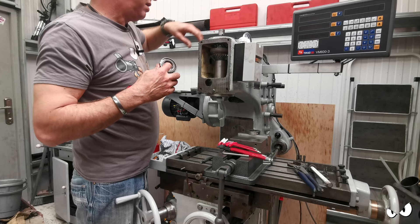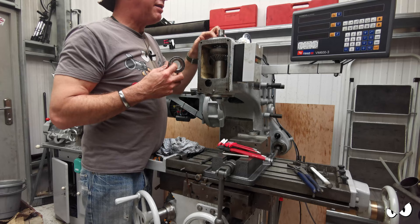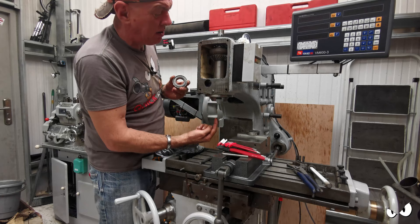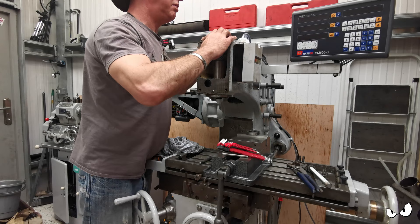New race is in the top, which I've got mucky as hell now. It's all right, it's just going to get cleaned out with oil. To get that race in, you basically have to bosh it through this hole when the spindle's out and you can knock it out the top - a bit of a faff but doable. So that bearing's going to go on the top there, which is nice.